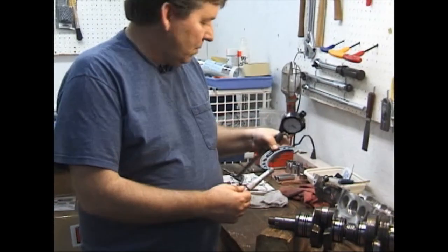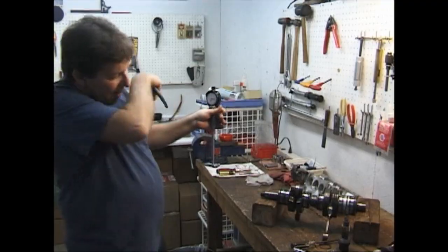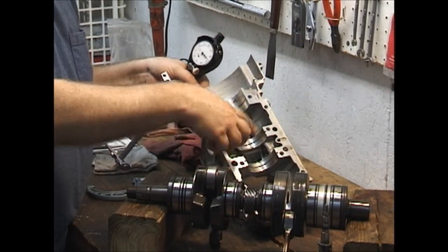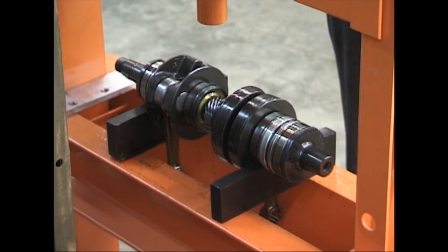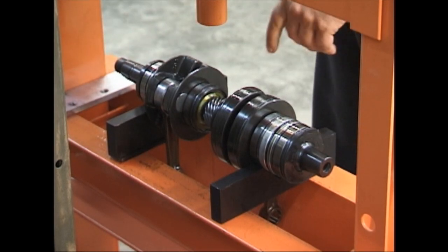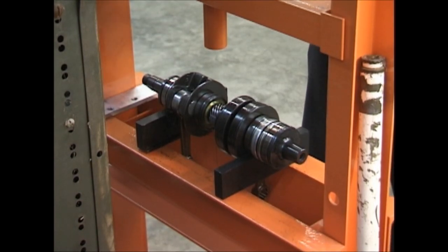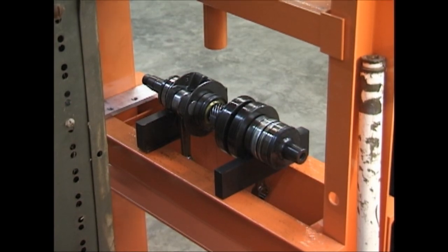Two of those tools I'm going to show you here — they don't leave my hands, they are not loaner tools. This is your micrometer. What you do is you mic your piston, get your maximum diameter on your piston, wherever that is, then you lock it. You would also use this dial indicator when you bolt your crankcase halves together to get the diameter of these journals, if you suspect wear. We're going to show you how we check for the straightness of a crankshaft. I have two dial indicators — we're going to measure this out on both ends and then on these bearings. We're looking for how much it's out; ideally the number should read zero, meaning everything is absolutely straight.